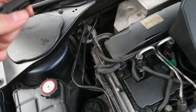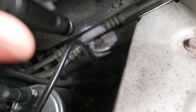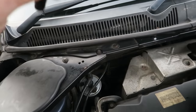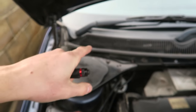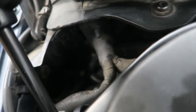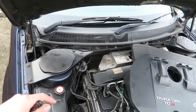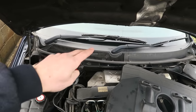I've been looking on the driver's side of the engine bay to see if I can find any rubber grommets. There is something there which I think is the clutch cable that's got a rubber grommet on it. I'm thinking if I take this cowling off where the windscreen wipers are, there seems to be a wire that goes into the engine bay there. I'm thinking I can route it from here up the side of the engine, through that grommet where the wiring goes through, and then somehow into the car. First step is to take all this cowling off.